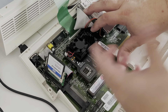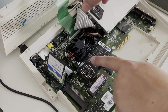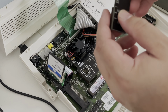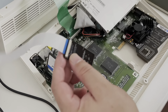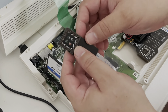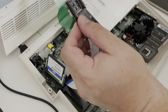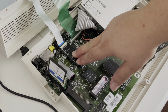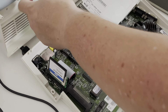Remember how hard this was to get on? Nice firm press — now I have to pop it off. Makes me curious: is this going to fit with everything mounted, and is there anything that's going to short out? Doesn't look like it — nothing actually connected here, so we should be fine. This clip has to go onto the Denise chip, and this crystal could be in the way. If you look, there's a notched side that matches the notched side on the Denise, so there's only one way for it to go on. Pressed down firmly, locked in place, and no interference with that crystal oscillator.